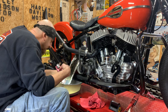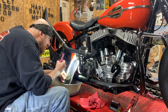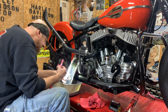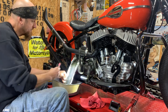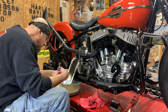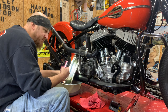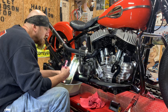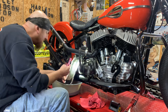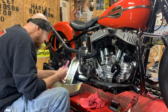Yeah, there's some glitter, but I would assume to expect that from 41 miles of riding and tight tolerances. Typically on the break-in you're supposed to change the oil at, I think, 100 miles — or maybe 50 — and then there's like a 500-mile recommendation, I think there's a 250-mile interval too, I'm not sure.